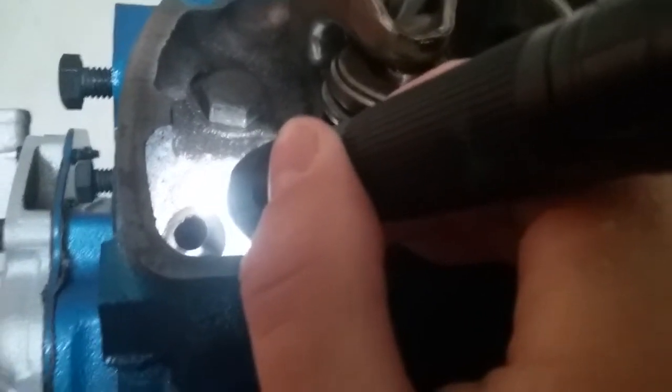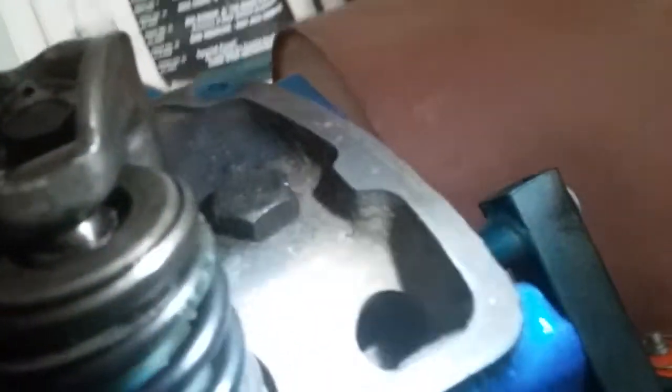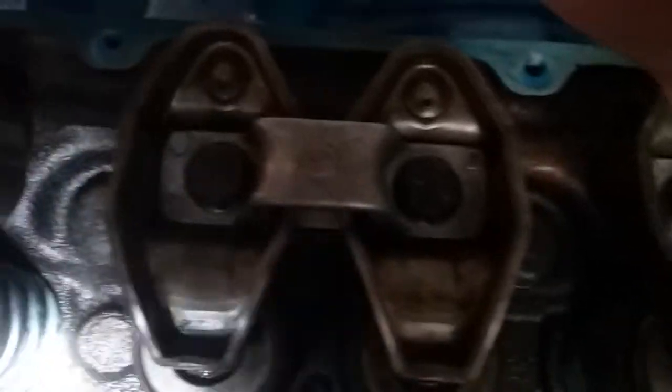There's your problem right there. The oil has to run on a horizontal angle to get through those holes. They don't just drape down. Same with the back one. There's your oil drain-back holes. Oil will just sit in this whole valve train under here and just turn into a swimming pool.